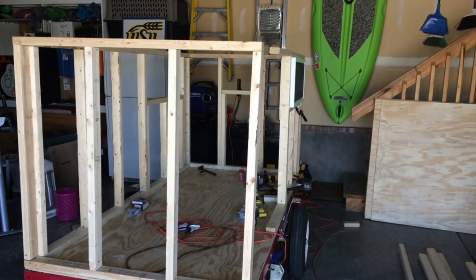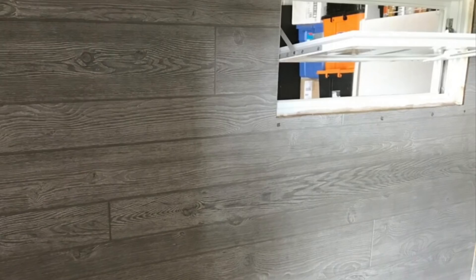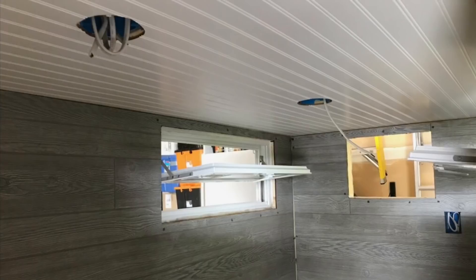Starting with the folding trailer, I attached half-inch plywood to the floor with high-grade bolts, waterproofed the underside, and framed the walls with 2x3s as you would a house with 2x4s every 16 inches. I used vinyl hopper windows, wired the trailer for lights and power with the help of my neighbor, and installed double garage door foam insulation and wood paneling on the interior walls and ceiling.